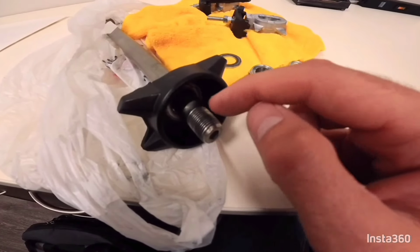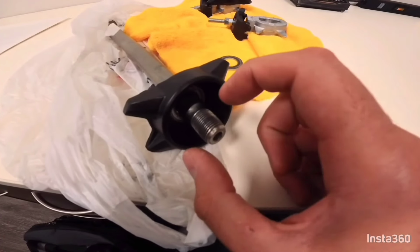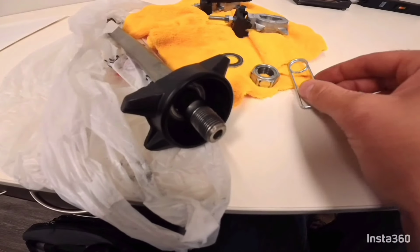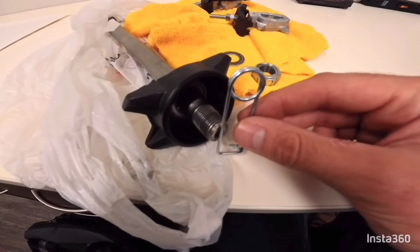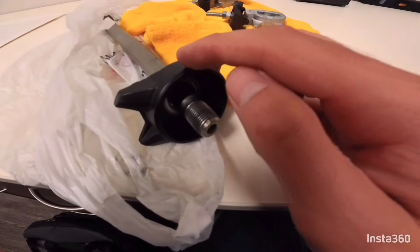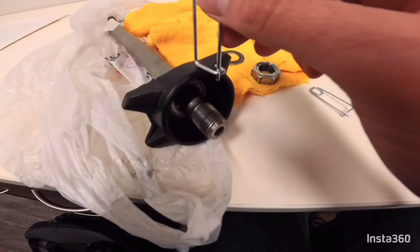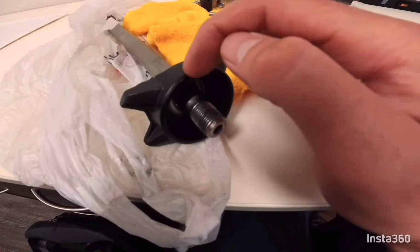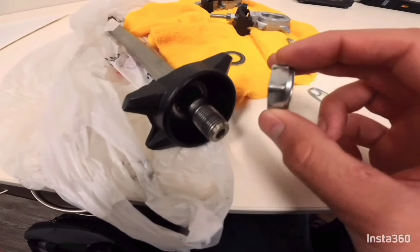It's important to keep a bit of grease on these threads to avoid any chemical reactions, but we also want to just be extra safe with a mechanism like this being our secondary solution to stop the nut just winding off. To do that, we need to make a notch in the top of here because the pin hits the top of there when it's through the axle. So we need a notch cut out here, a hole drilled through the axle, and a different nut.